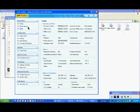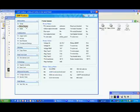Next one, printer sensor. It's going to tell you the sensors of the printer. It's a little bit dynamic, so, for example, the temperature here can change depending basically on what you do with the printer and so on. And just to be sure that you print with the yellow panel, you should have here the tricolor state, which is the color sensor. It should show you yellow panel. So you know that the next panel to be printed on the next card will be the yellow panel, which is the good sequence: yellow, magenta, cyan, and so on.